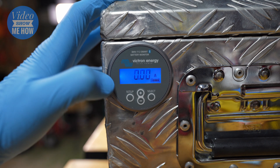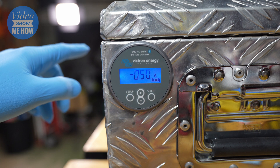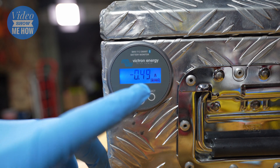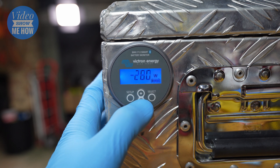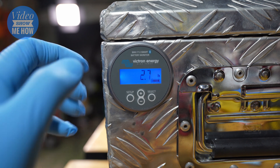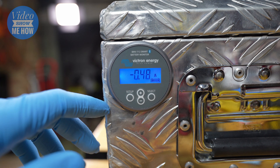I'll do a quick demo — going across to our amps and flicking the compressor on, you can see our peak draw was about 30 amps. There's the half-amp draw for our fan that's constantly running. Then down that end with the compressor going you'll see it spike back up — running non-stop we're drawing about 20 amps, about 280 watts. That shows how many amp hours we've used, state of charge, and how many hours we've got left — constantly calculating and getting more accurate over time. We drop back down to just the half-amp for the fan, then turn it off — back to no draw.